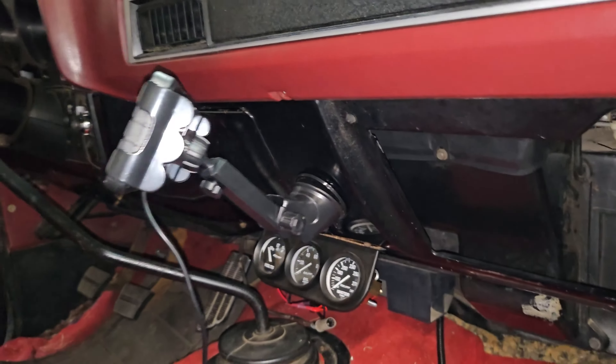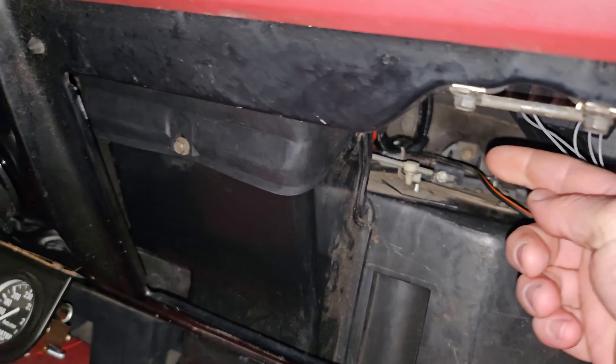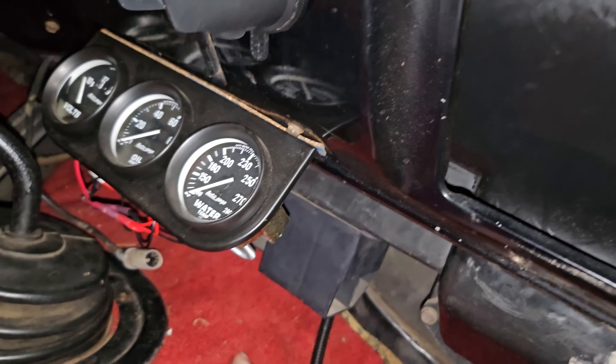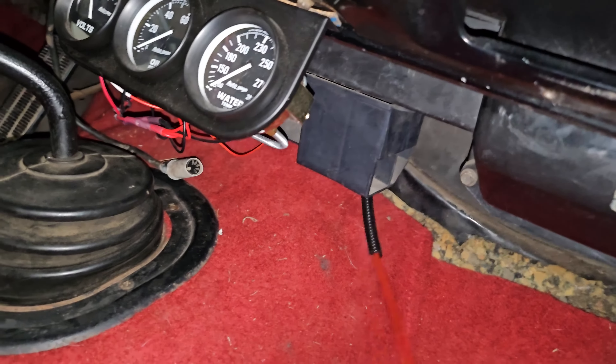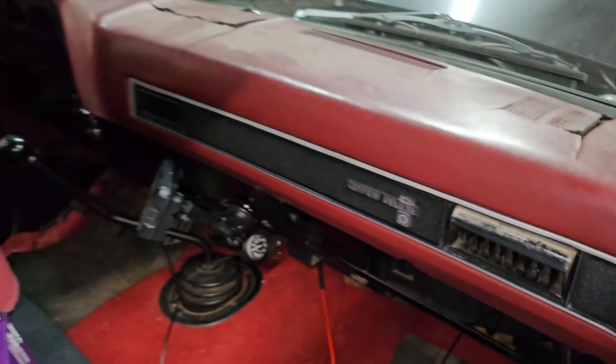Great thing about a metal dash. I moved my monitor down here. In case you have a C10, if you run your wires up through here, there's a hole right there that can come out and you can run into your carpet or whatever you need right there. The amplifier still needs to be tucked, but cover this up and everything will be tucked away.